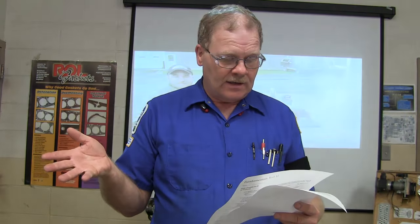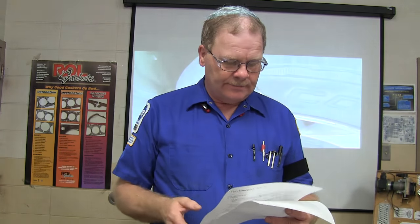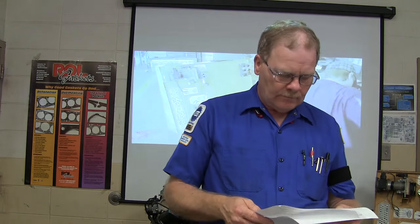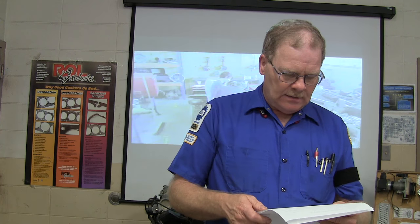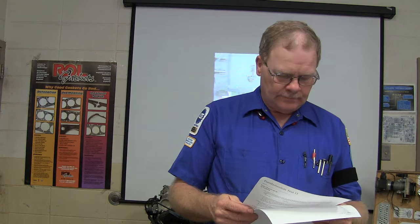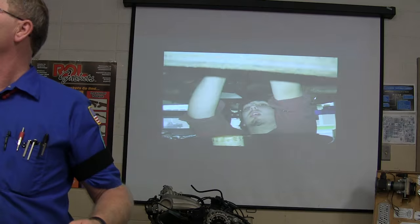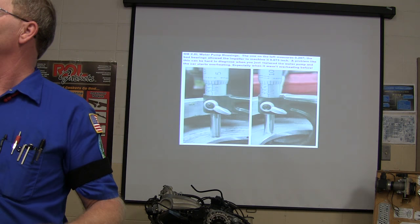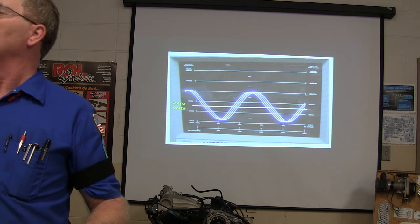We knew about that, right? Mm-hmm. And you ought to avoid topping off your gas tank because it goes into the expansion tank. The charcoal canister may get saturated. This is a charcoal canister on this picture right here. There's the expansion area, but if you get enough in there to where it goes over here and gets in this thing, now let me tell you how that manifests itself.